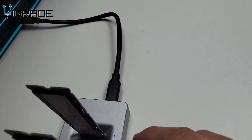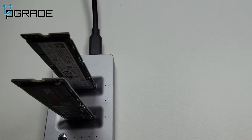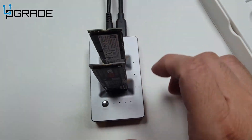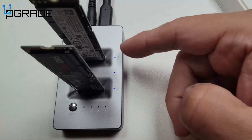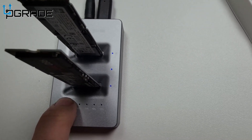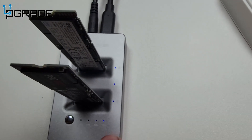I've got both drives plugged in and I can see A and B showing up, but you can't initiate the clone while the USB data cable is connected. You have to disconnect the data cable and connect only the power. Let's do that — disconnect the USB, then connect just the power and turn it on. Once you have the two LED lights with only power connected and no data connection, hold the button for three seconds.